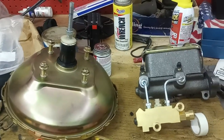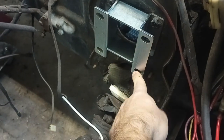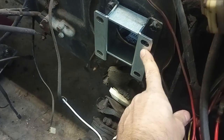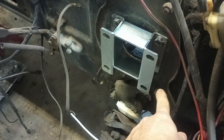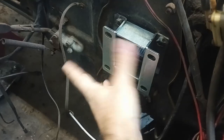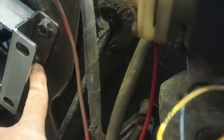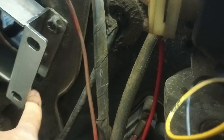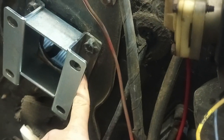I'll show you what's in the firewall. So here we are. Here's the adapter they give you that you've got to use — it's flat instead of being angled. The booster goes through these holes. And it's unfortunate because the booster holes almost fit the firewall holes — like it's so close, but whatever. So I got this in, I had to drill — if you can see — that's an original hole that bolts in, that's a new hole I had to drill, and then down here is the other original hole. So I did have to do two new holes, not the end of the world.